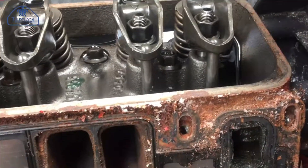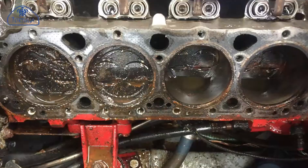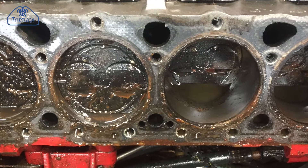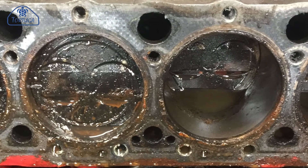There are 17 cylinder head bolts on each side which came out easily and without any issues. Once the cylinder heads were removed I was able to get the first look at the condition of the cylinders. This appears worse than it really is — the gunge is the remains of the WD-40 that was pumped into the cylinders as soon as the spark plugs were removed.